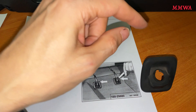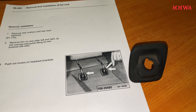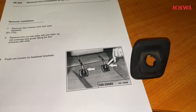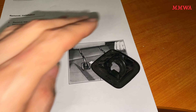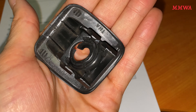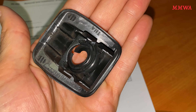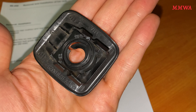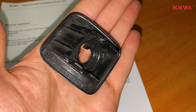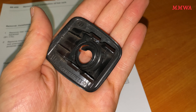It is mandatory to remove those covers because of the shape of the arms — the headrest can't be removed with those left in place. But you can unclip them from underneath, from inside, just with finger pressure on the four clips there, and hopefully they don't break off. I was successful with this extremely baked example on my red project.